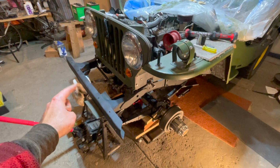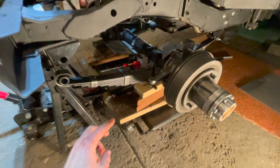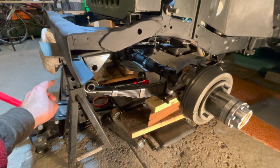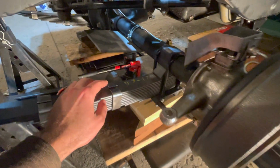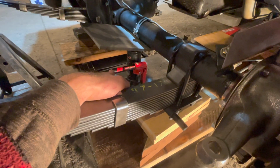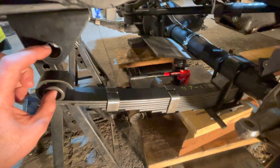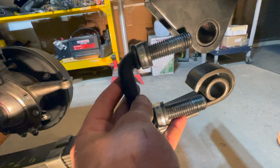We had to readjust the system on how the Jeep was jacked. As you can see, we had to get it in line, so we get our shackle bracket now in line. And to do so, we put jack stands on the front bumper instead of it being back there. And now we also have a bottle jack right below our axle. And when we pump our jack, that will raise the whole axle and leaf spring assembly. And then this will close the gap here and make this closer so we can get our shackle through both these holes. I'm just showing you the purpose of the jacking.